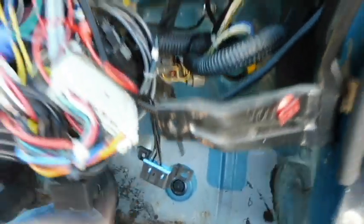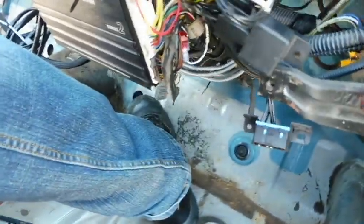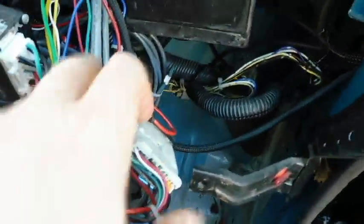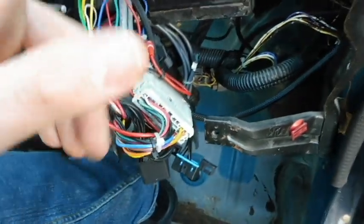We've got our A2 harness entering the cabin right here at this point. Let's go to the other side so we can get a better look. The A2 harness runs in here, and basically the engine harness is going to plug into the ECU. After that you've got what's called a swap harness - people familiar with K-swaps know that. I bought a swap harness for a standard K-swap with RSX-S wiring harness for an EG chassis.